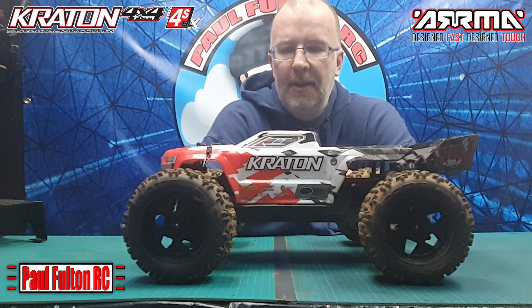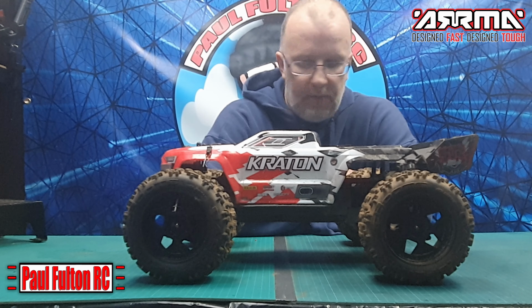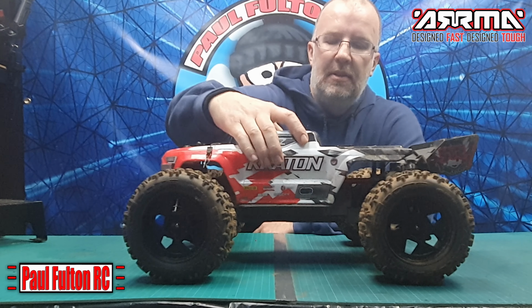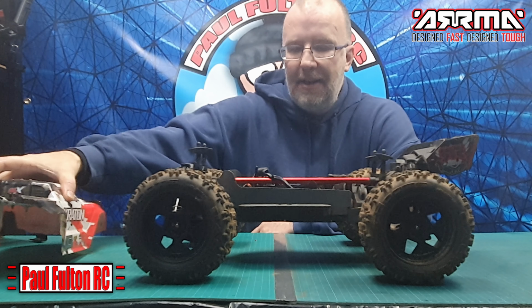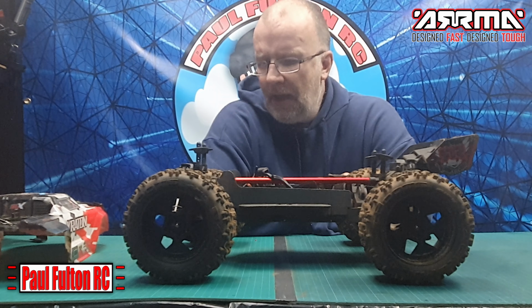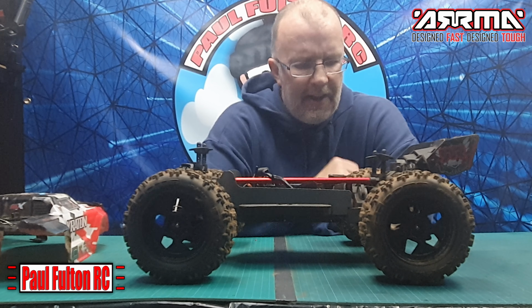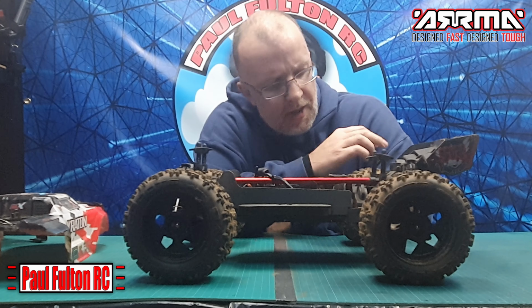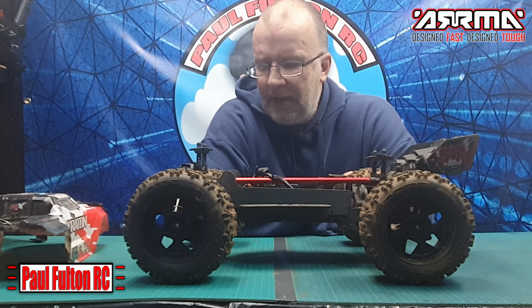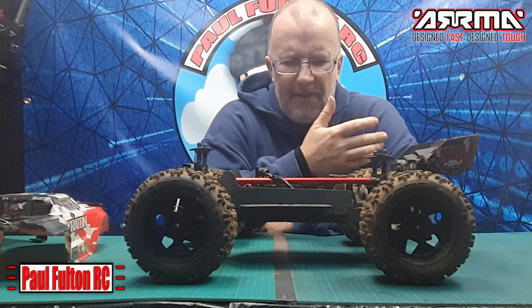This was my first Arrma. I'd done my research, wanted something nice and durable, plastic like the good old days, so I got this. This is an excellent beginner's RC. Quite a few upgrades to it. Aluminium pivot balls all around because the plastic ones wear out pretty quick, and HR shocks front and back because the original ones leaked pretty badly. I've had 3 of these. Well, I'll say 3. I've had 2.